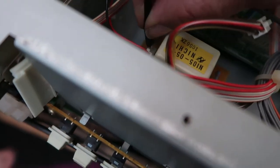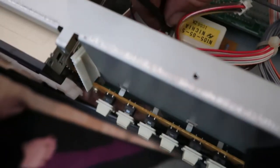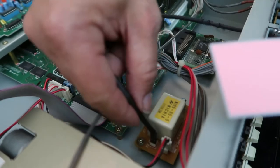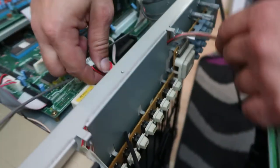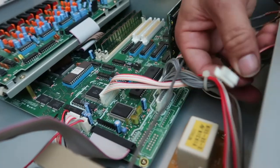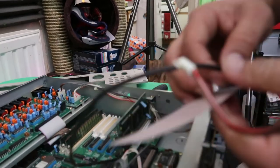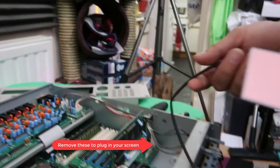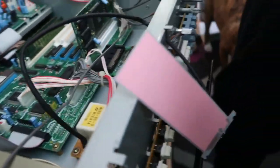You'll see two holes where the old backlight pins were — your new retro illumination light should just plug in here. Apparently the polarity is the same and you can't plug it in the wrong way around, so that fits perfectly. Before you do that you need to thread your wires through. Once you're happy it works, you can disconnect these old wires because you won't be needing them. I'm tracing back where the wiring went and pulling it through.